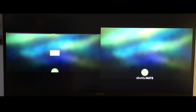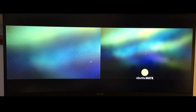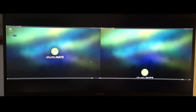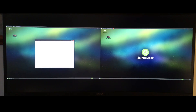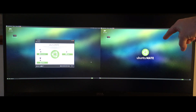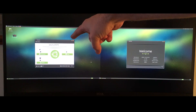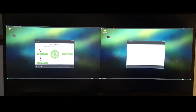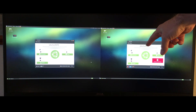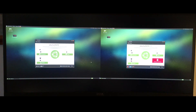I'll log in to both of these. Probably the biggest performance difference between the two is the storage. The Raspberry Pi has a 32 GB Samsung Pro Plus micro SD card, and the Intel NUC has a Samsung 850 EVO SSD. I did a quick benchmark — nothing scientific — and I was getting about 13 to 13.5 megabytes per second reads on the SD card versus about 530 MB/s on the SSD. That's a huge difference.